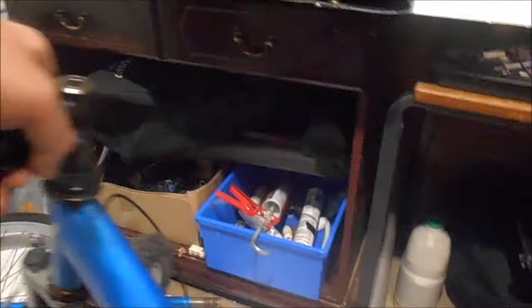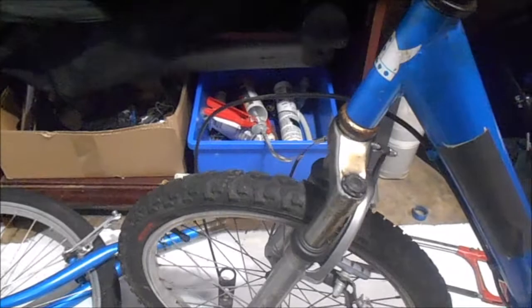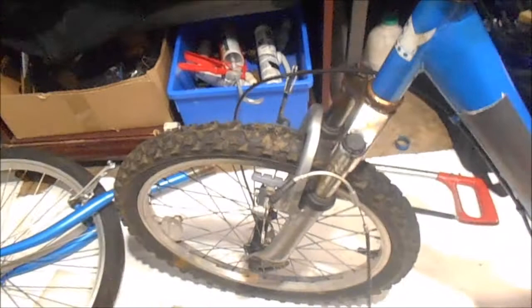We took off the front forks and the wheel, also the stem, and put them on the trike. I've just turned it round to show you the back of them. It was a bit of a pain — I cut a few little nicks out of my finger. Stems are always a pain; you really need to be quite brutal getting some of them off, especially if they're rusted. Use WD-40, let it soak in, use the right spanners, and just keep going.